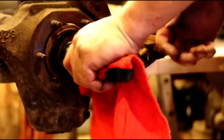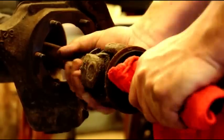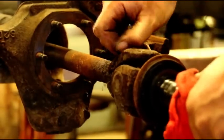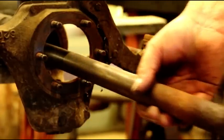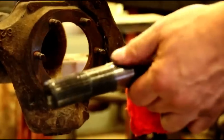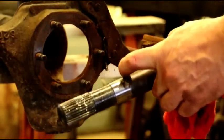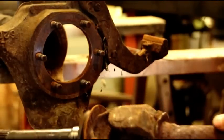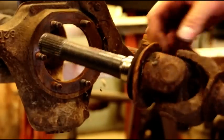Okay, we're ready to pull the axle now. As you can see, I can't turn that U-joint — it's completely rusted. The axle shaft dust collar here is almost completely rusted away. And that is your inner seal surface — I'll polish that up before I put that back in. But obviously we're going to need some U-joints in there, and I'll clean the axle shaft up and see what that looks like.